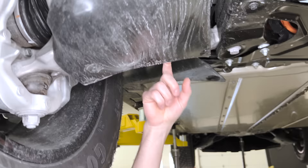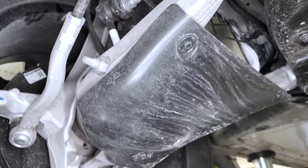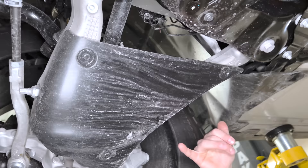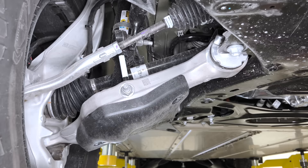Regarding the shield, it's definitely an aero provision, probably also to help from stone impingement at the leading edge. My criticism here would be the number of fasteners — if you're going to have this shield and you've got a casting, it'd be great to see a way to snap that in place versus using three separate bolts, or at least a clock-and-lock or tab-and-set solution. But it's still going to fill with mud when you take this off-road — that is guaranteed.